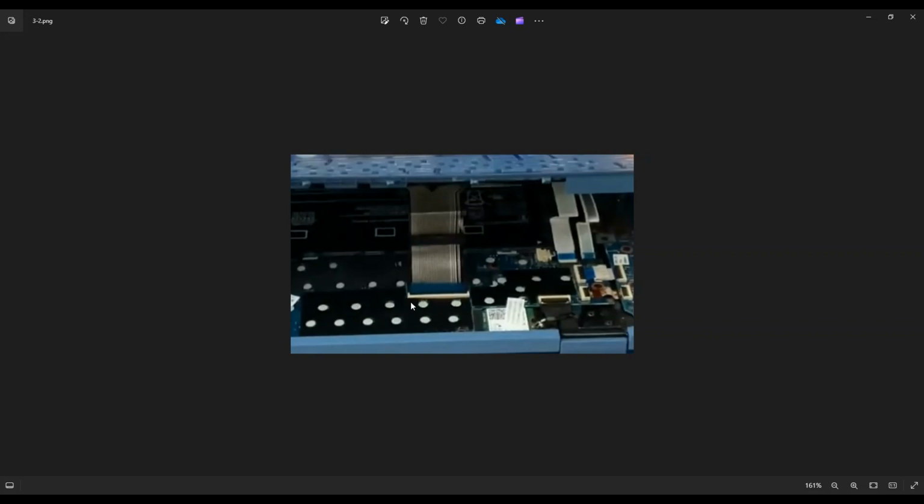In order to do that, these clips right here, these are very breakable, guys, very fragile. The way these are designed is there's a black retainer clip that opens and shuts like a book cover. The open side, where it opens, is the ribbon cable side, and it hinges right here in front of you. So the way to get these out is to use your fingernail or a small flat pry tool, slide it underneath that black retainer clip from this side, from the far side, pop it up gently, and then you can slide the ribbon cable out. And that goes for these as well.